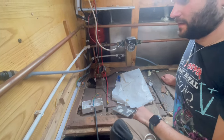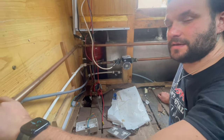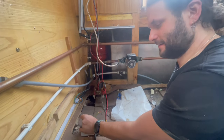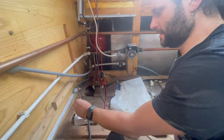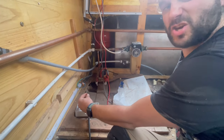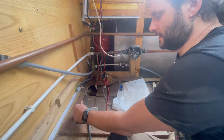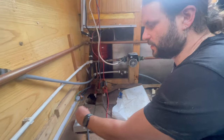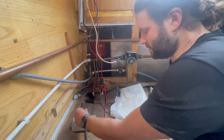And then also refitting the water pump that was leaking. I'm kind of copying what came out of it, but the blue goes to the blue, the brown goes to the brown, the green and yellow - that's the earth. So that's always really important. I can never remember which way around it is. I think brown is live and blue is neutral. That's good to know.